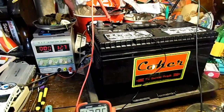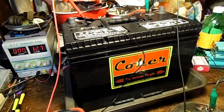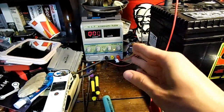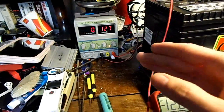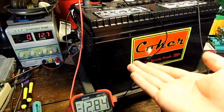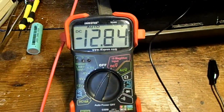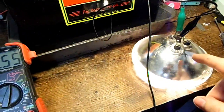This battery is blowing my mind — it's acting like a lithium-ion battery or something, not like a lead-acid battery, even a brand new one. After about three hours of charging it was down to only pulling 100 milliamps at 13.0 volts. I let it charge for about three days and it was only pulling about 30 milliamps of current, so it didn't really pull that many amp hours — maybe only 10 at most. But now it's at 12.84 volts.